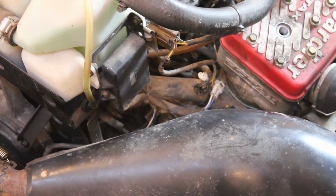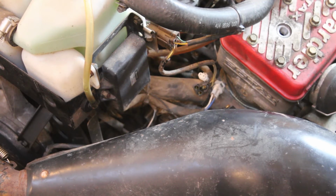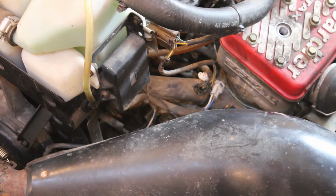So it sounded like quite a few guys had those burned up just from heat coming off the exhaust, so that is a possibility here. I don't know if that CDI is entirely encased in the backside or if it's something that we can take apart and check connections, so we can definitely take a look at that here in the future too. But let's get a meter on those plugs coming off the stator and see what we can find out there.